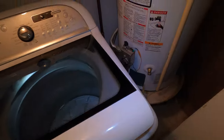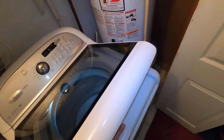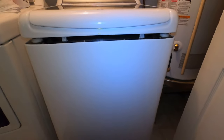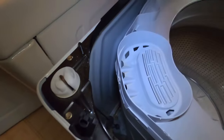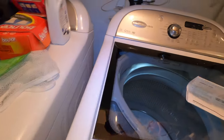So we're going to bypass all that, get into diagnostics, and actually test these valves out so I can show you guys what's going on. What you need to do — you can either watch this video or you can get the tech sheet out like I'm doing. I don't see this washer a lot, so I have to get the tech sheet out to remind myself what positions the switches and stuff need to be in so we can actually test what we want to test.